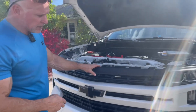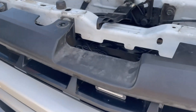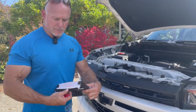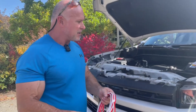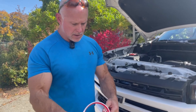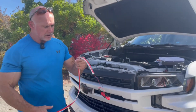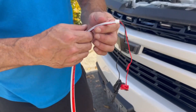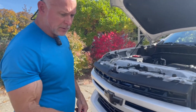I may not have to go any further than this to do the wiring I need, so I'm going to take a quick peek. You can see I've got a pretty good gap here, and I should be able to run the wires right up through there. Let's see what we've got in the package — just what we suspected: one long tube of LED strip. A couple things we're going to do: test it before we install it, and then seal these ends because they're inherently known for letting moisture in, which can short out the whole thing.